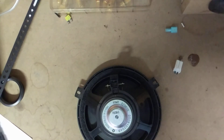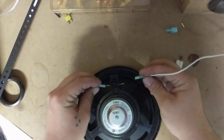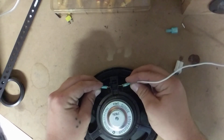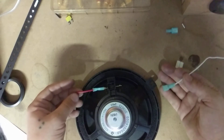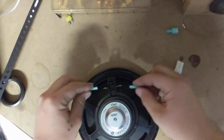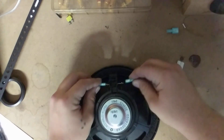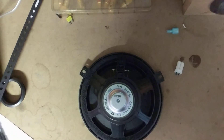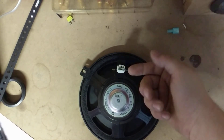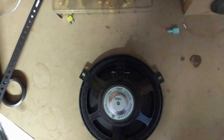In this situation I've got two test leads here that are powered. I'll put positive and negative on, and you can see the face of the speaker is actually going out — which means this is the correct orientation: this is positive, this is negative. If they were swapped, you'd see the face suck toward the magnet. From there, in this case the negative was the black and white wire on this side, and you'll know the correct polarity to hook up your new speakers.